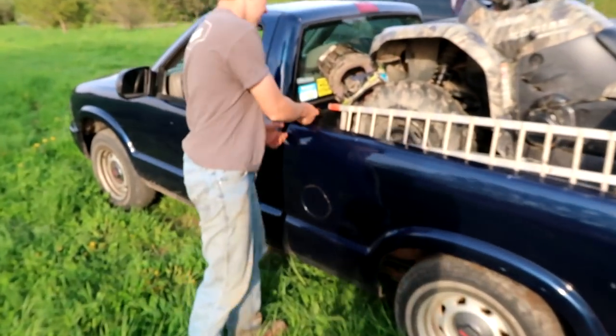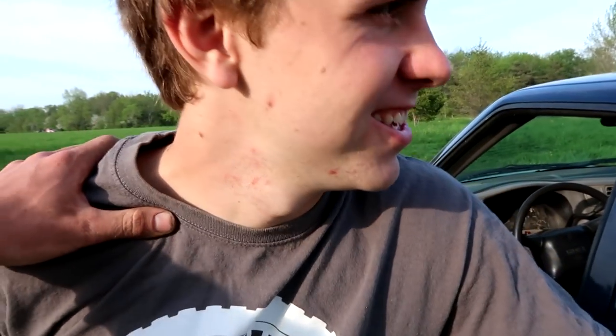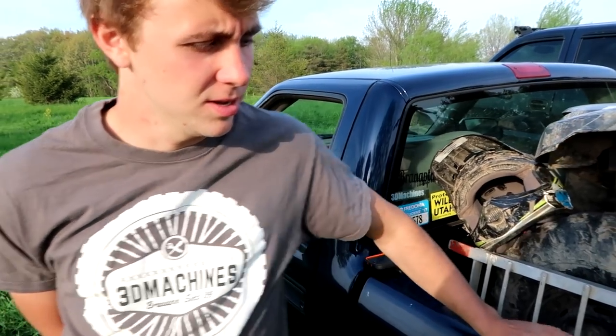Jake and Danny are here now. Jake, you're still hauling a rig that's not yours? He confirms — for today. So what are you riding today? He says he's a passenger. What happened? His Beta is at home. A couple days ago he had some issues with it — it wasn't idling very good. Beyond the idle there was still plenty of power. He says he sucked a little dirty air around his air filter, got his carb dirty at some point. He cleaned the carburetor, but now thinks he wore his rings out. He's going to compression test it to see what's going on.